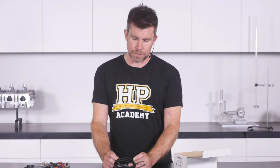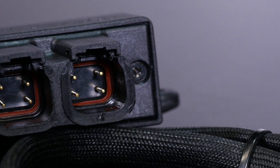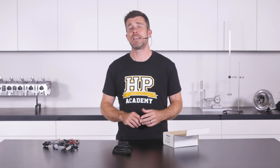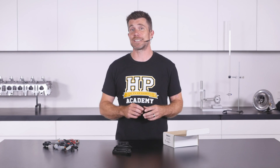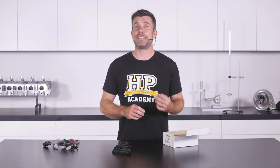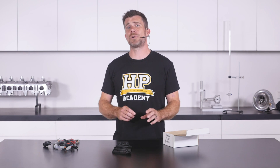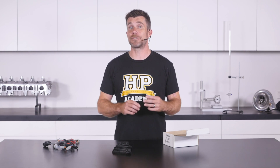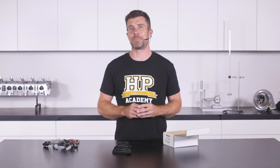On the underside of the unit there are two four pin CAN connectors. This makes it really easy to daisy chain multiple wideband controllers together, which you may want to do if you want to measure individual cylinder exhaust gas lambda — requiring a lambda sensor for each cylinder on your engine. Each of the wideband controllers does need to transmit its data on a different CAN address, but that's easy to set in the software so it's not a big issue.